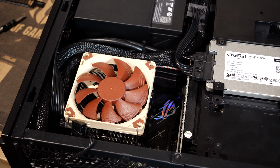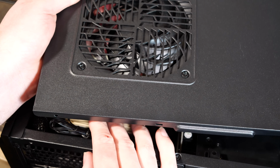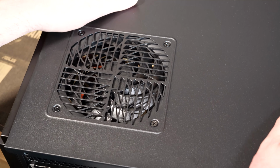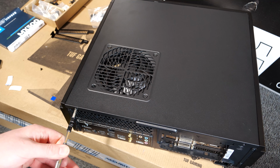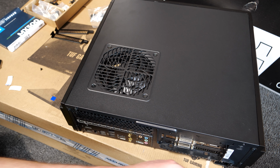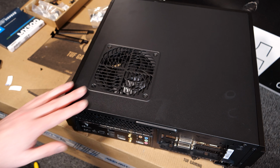And just a reminder, when you're putting the panel back on, try to squish this cable tip to the back, just because you don't want to hit the CPU fan. Probably good, when you get the computer, to do a test power on with the integrated graphics first before doing all this, just to make sure it survives shipping and everything.